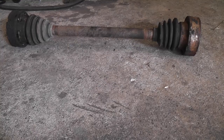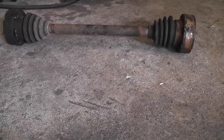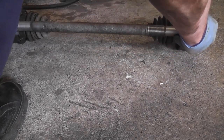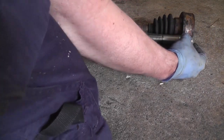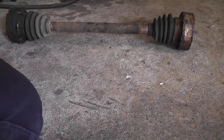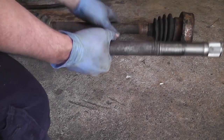There's one shaft out. Let me offer up a Porsche 944 shaft and see if they're the same. I think they might be — if that's the case I'm a very, very happy man. Oh, you beauty! They are exactly the same part. So there you go, Porsche 944 owners — your beautiful little sports car has Volkswagen Campervan drive shafts in it. That's brilliant news. It means I don't have to touch these shafts at all, which I wasn't looking forward to.